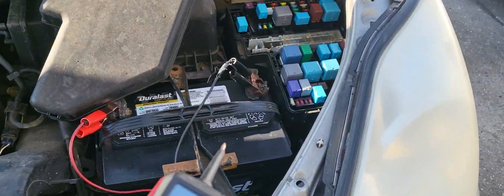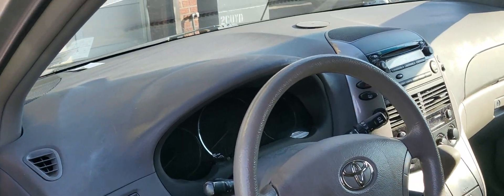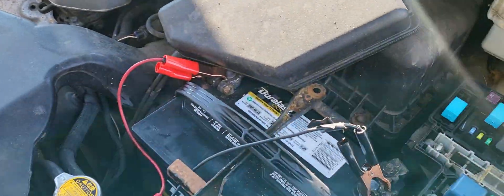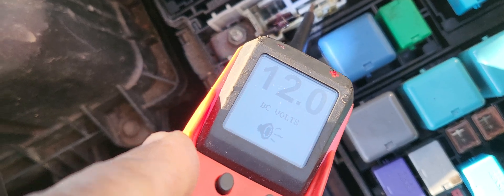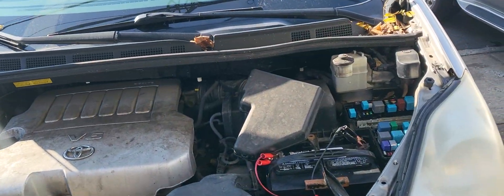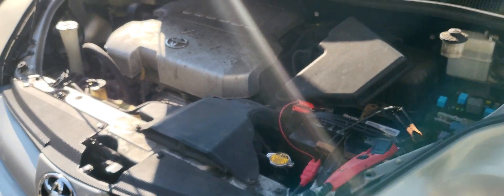We have no actual brake issue — the problem is here in the charging system. Our problem is already found and solved. When you start the car, there is power on one side, but after touching the damaged fuse link, there's nothing — no power on that side. Here we have 12 volts fully, and here we have nothing. The car's charging circuit is completely disconnected. Please check your car always when you have these kinds of issues. Visual inspection is very important. Thank you for watching — this is Mohammed Haroun Idris, see you in another video.